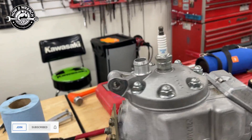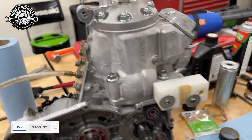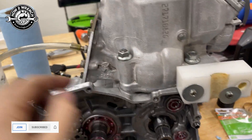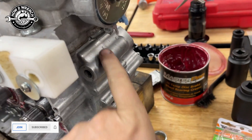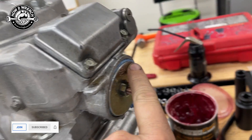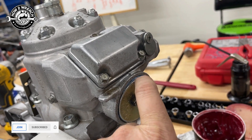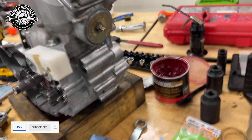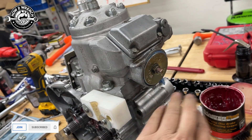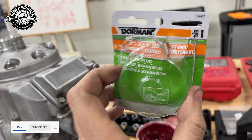What we have here is the crankshaft seal exposed. We're going to spray soapy water around it and be able to see if we get air bubbles out of it. We're going to do the same thing around the crankcase seam on the engine side. You can see I have the exhaust plugged — it's being a little bit difficult, creating a tiny leak. I think I've got it sealed now. I just used a paper towel and electrical tape — I couldn't find one large enough locally. These are just expansion plugs you can get; I picked mine up at O'Reilly's, Dorman brand — easy to get.